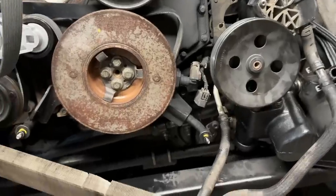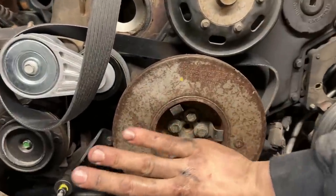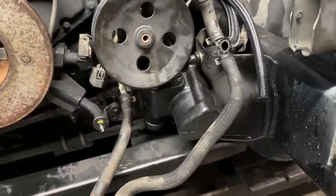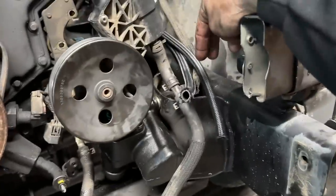Okay, so we took advantage of not having the water pump. We got our new belt tensioner on, new belt, our fleece pulley on, 6.7 fan pulley, our 6.7 damper, factory bolts. We have our new CarQuest special Advanced Auto Parts $200 steering box, and our trans lines are ran up here. I also ripped the coolant line out.